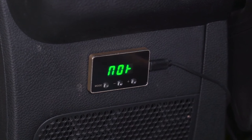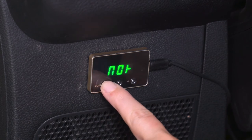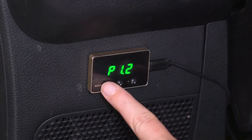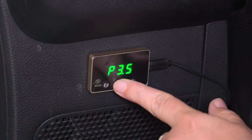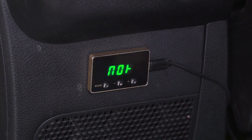Once the Jeep is turned on, your throttle controller will turn on as well. It should illuminate with green letters in this first setting — this is your normal or stock setting. Press mode on the side to move to P1, which is your comfort setting — the balance between sport and economy — and you can go up as well as down with the two buttons to fine-tune it. Hit mode again for P2, your sport mode. P3 is your race mode, and again you are able to modify and fine-tune it. Last but not least, you have EC, which is your economy mode, and you can adjust this as well. If you hit the mode button one more time, it will reset everything back to stock settings.